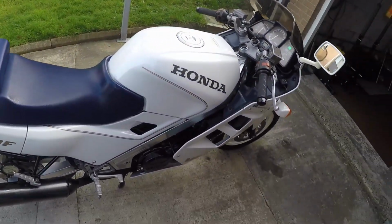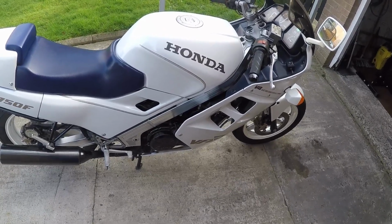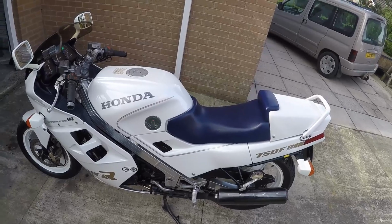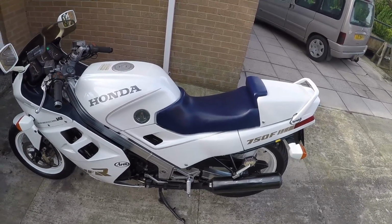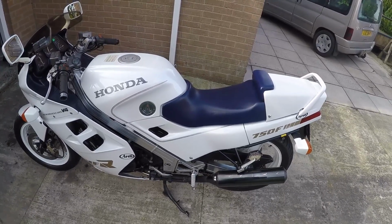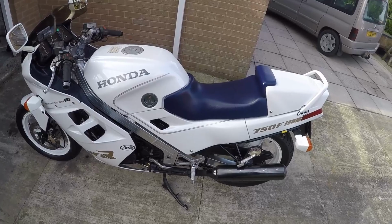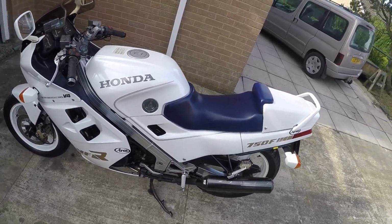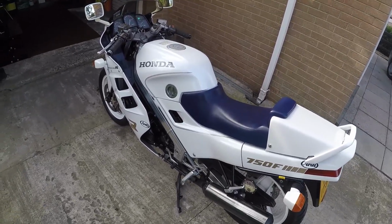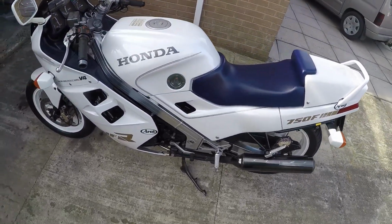I can't honestly remember what I videoed and what I didn't video, but just in case I didn't video it all: the carburettor leaked after the fitting of the Chinese gear, and I discovered that the needle and seat valves were different size, and I didn't set the float heights, which I then subsequently looked into, and I refitted the Japanese original Honda needle and seat, set the float heights, rebuilt the carburetors, fired them back on again, and this is the result.